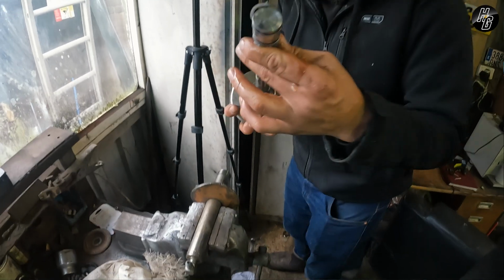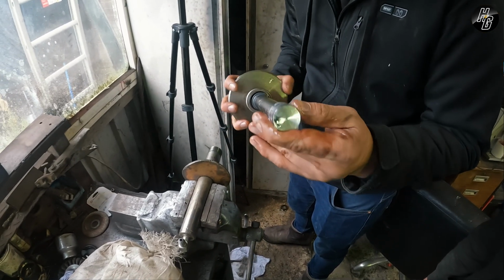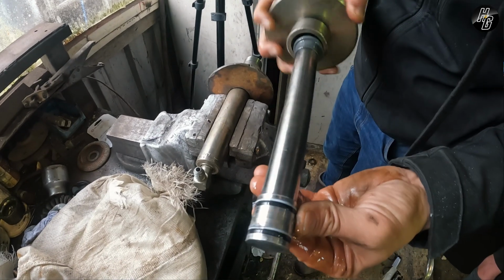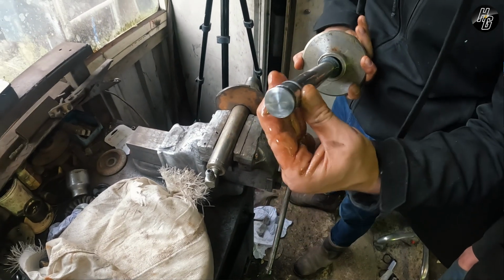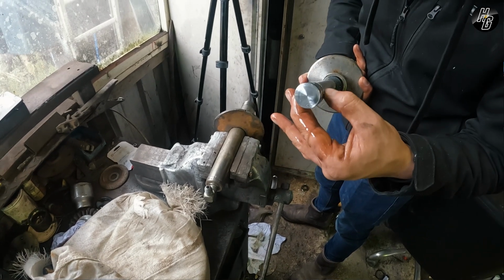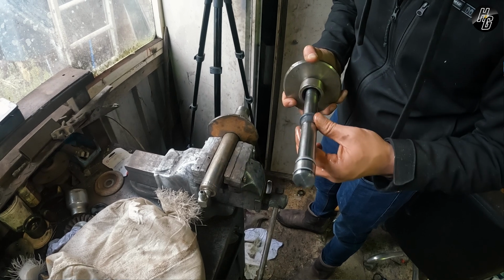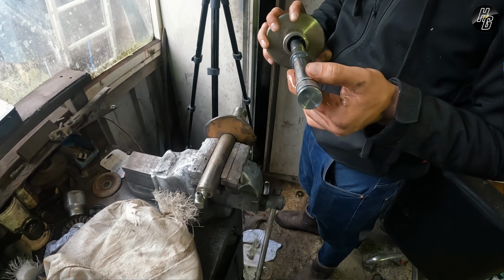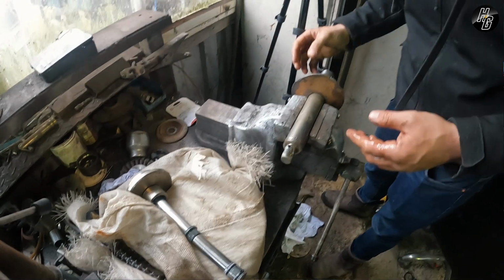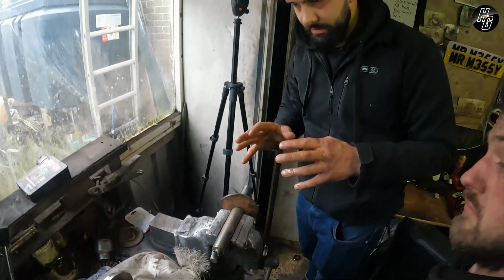So guys, what you can see here, those little plastic horseshoe looking things are a little bit like piston rings. What they do is they shim the actual rubber O-ring nice and tightly in that gap so it can't move up and down. Also, it allows the oil not to be passed by either side. But as you can see here, the plastic has worn away slightly on one edge, and it's also split one of the O-rings. Next part is trying to find some O-rings that are going to fit. But this is a positive. I can assure you guys, a positive.